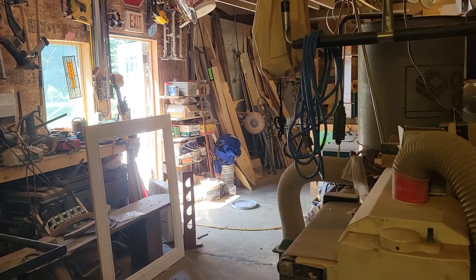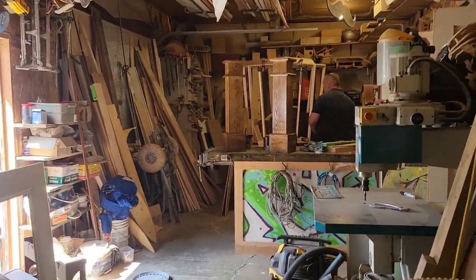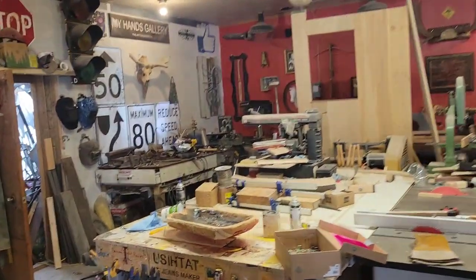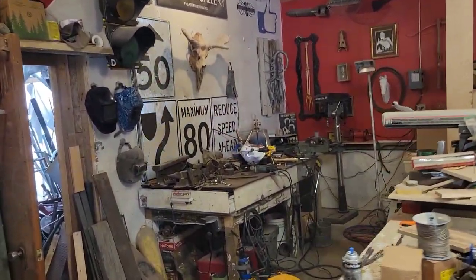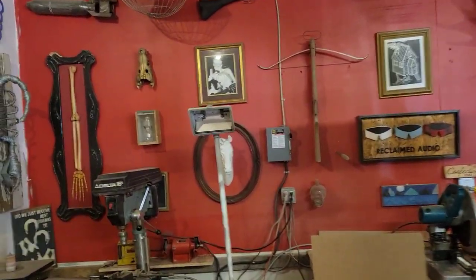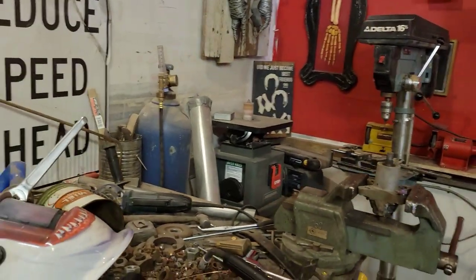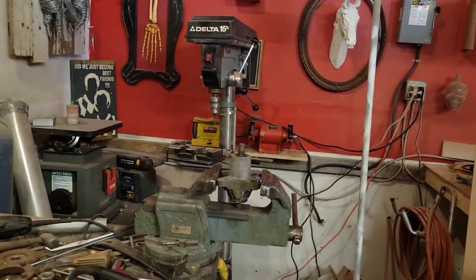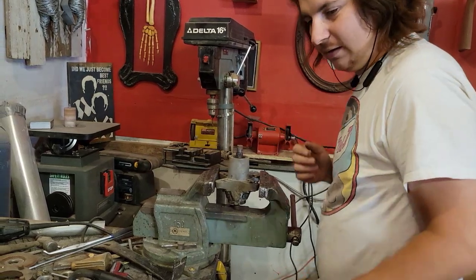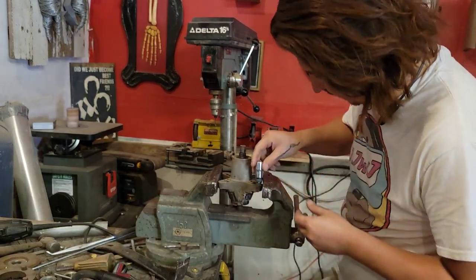Hey, what's going on? Oh, I'm frustrated. I'm trying to fix my lawnmower, but I sheared a bolt off in the blade spinny housing thing. I can't drill it out because the bolt is too hard for the drill bits that I have. Can you try to weld something onto it? I have tried that, and I am trying that again. And it's too hard a steel to drill out? Yeah. I thought all the welding here would have annealed it, but it doesn't seem to be soft enough.